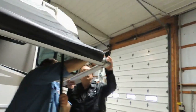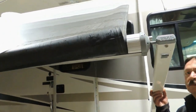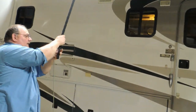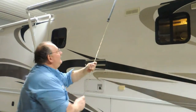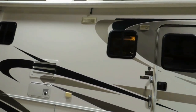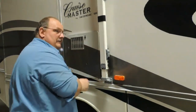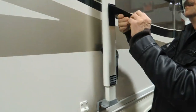Located right here is your lock. To roll the awning up, you flip it the opposite direction — it only goes one direction at a time. You flip it to roll down and flip it to roll up. Use a broom grip on it because it is spring-loaded. If it gets out of your hand it's going to forgive you a few times, then you're going to take the abuse and break it. Lock it in. Then turn your knob towards the rear of the coach just enough to snug it up.